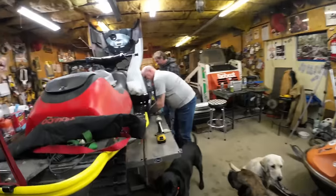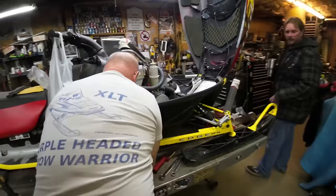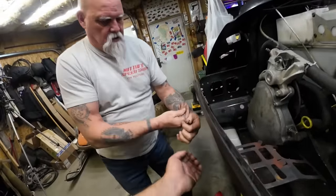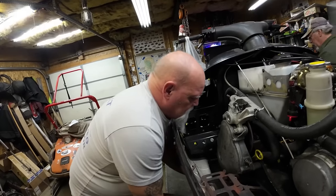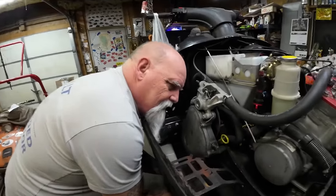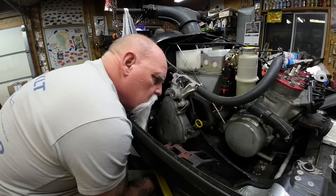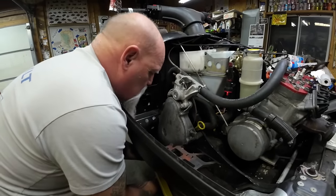The flange looks beautiful. The bearing race is split — it's not going to be a big struggle on that race. We're going to drain the chain case. Pop off the brakes, pop off the cover, keep disassembling. Watching the oil drain is about as exciting as watching paint dry.